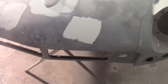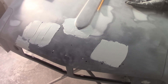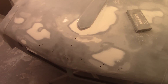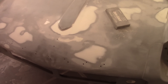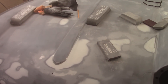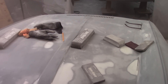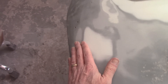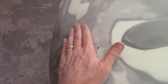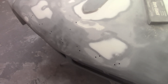Second round of glazing putty applied — put it on kind of thick, maybe a little too thick in a couple spots, but so be it. I'll work these out, let this cure up. In the meantime, like I mentioned, I'm going to go over to the body and take the sander to it. Got those spots filled with glazing putty, happy with the way that's come out. I still need to go over this with 220 and 320 — actually I'll go out to 220 with it since I'm going to another layer of epoxy. Pretty happy with the way that nose feels, pretty flat. Filled those couple spots, you can still see some artifacts but I can't really feel them.